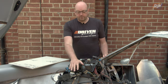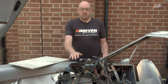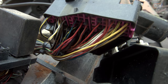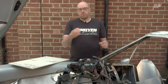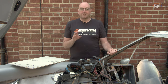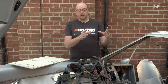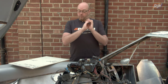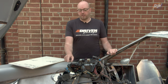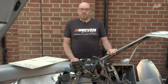After poking around in the back we've ascertained that this does not have a load of shorts, and if it does it's not on anything that we care about. We've blanked off all of the tails from the fuses we've removed because we don't need them — we'll just wire things in if we need extra fuses later. The main one we need to add is the blower motor. We took that whole system out because it all went through the climate control module in the TT, and we are not putting climate control in this.